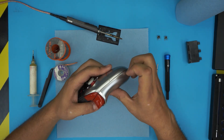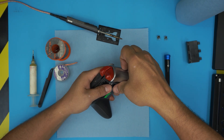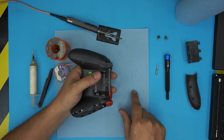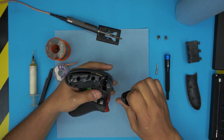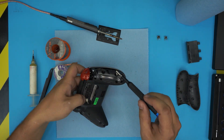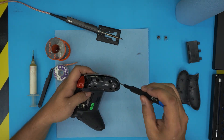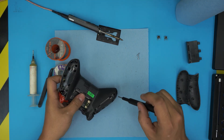You're gonna peel off this side — put your fingernail right on the side, grab it, and bring this side up with really hard force. It feels like it's breaking but it's not — you just have to pull it up like a can. All the dirt and dust in there is just gonna fall off. Grab a toothbrush and clean up once you remove this. Then use Torx number nine and remove one screw, two, three, four screws. There's a hidden screw right on this cover — you have to rip the sticker to get to it. Remove the four screws first, then go ahead and turn on your soldering station.